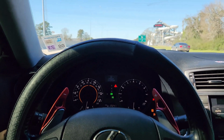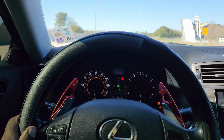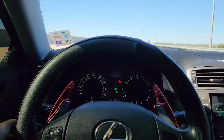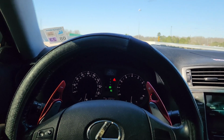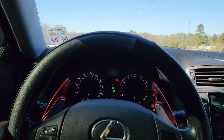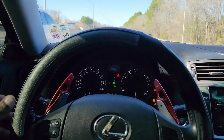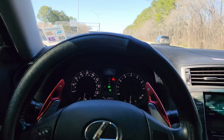So y'all saw that it didn't go to 7,200. Now I don't know if it has to go to 7,200, but I would like it to shift where it revs out. But if you're not getting any power past 6,500, then there's no real point in shifting that high. But if you do get a little bit more pull shifting that high, then why doesn't it shift that high where it's supposed to?